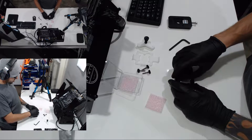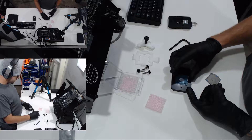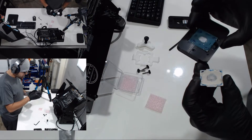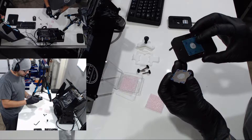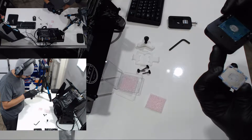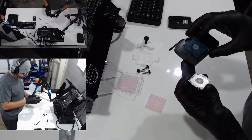If it comes off nice and easy, that's a bonus. You can see the small amount of silicone I used didn't really create any distance from the die. The silicone was nicely pushed out, so what was holding it in was probably the little excess. I used a little more Noctua thermal paste than I should have, but it looks like we had nice even pressure — maybe a little more in the center, which is cool.